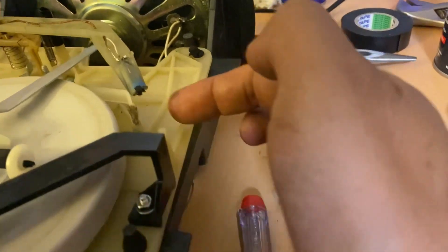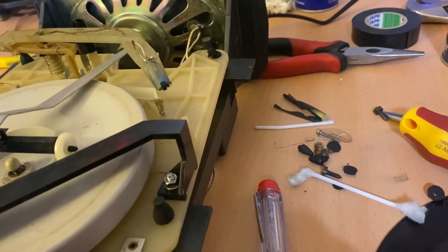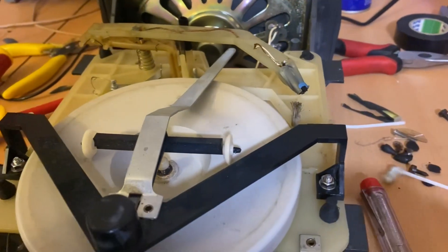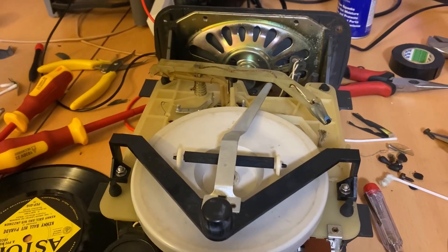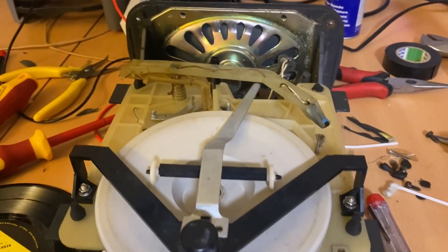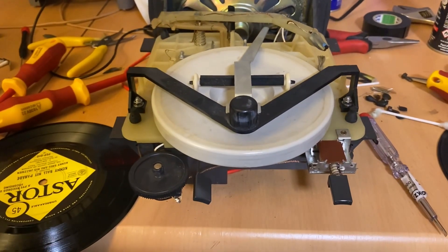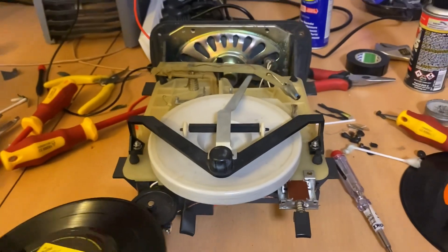It's quite fascinating - it's got a little brush over here that moves past the cartridge when the record goes in, and that cleans the needle. So it's got its own little needle cleaning mechanism. It's got a pause button which just lifts up the arm. You wouldn't want to play any nice records on this - there's a bit of preload on the arm, probably running about 10 to 15 grams. It's incredibly heavy, a lot of down pressure. Volume control and eject button for manual eject.